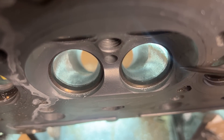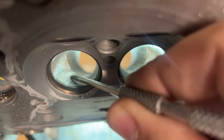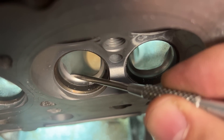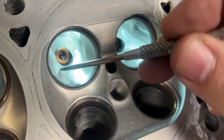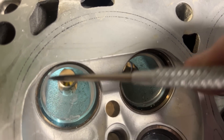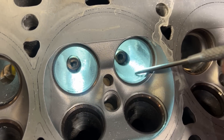Check that out. If you compare this — look, a nice turn. I widened this up here on each corner, and then you compare that to the OEM — look at that, this one is all choked up. Let's look at the bowl side: side two, completely opened up. Looks way better than the OEM. OEM is all choked up, and now you've got something that looks really good.